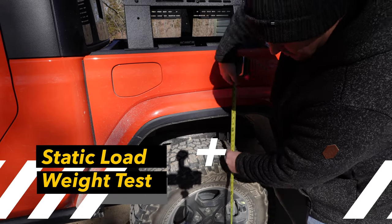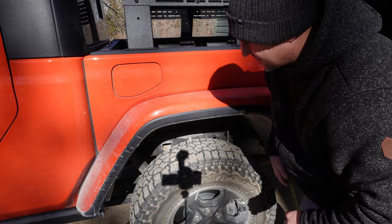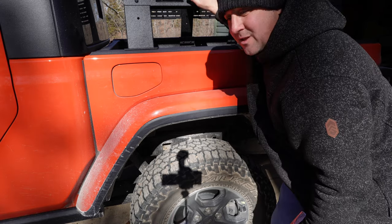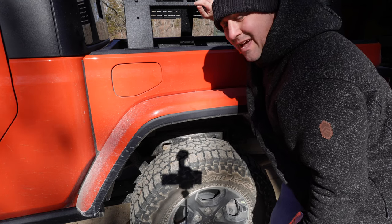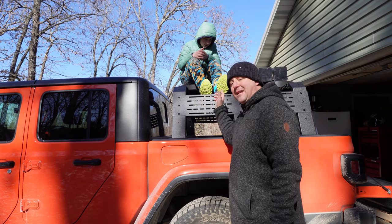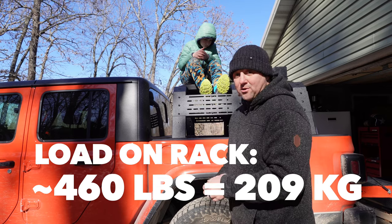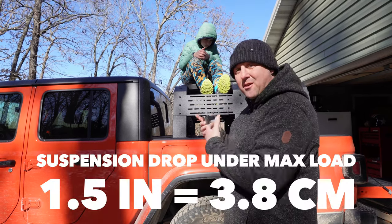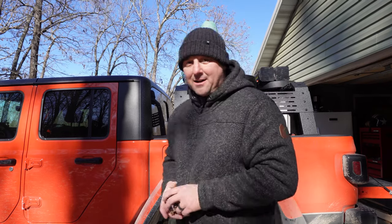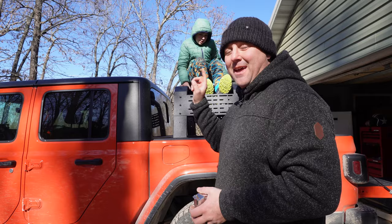We measured the fender height at just about 40 inches when we started, and with the 126 pounds on it, it's still just about 40 inches — so the weight didn't really depress the suspension. But let's throw some weight on to simulate 400 pounds. I've got four 45-pound weights at 180 pounds, and two 90-pound weights — another 180 pounds — bringing me to 360 pounds. Plus my son at 100 pounds, I'm at about 38 and a half inches. So if you load this thing down with 400 pounds, you're going to get about an inch and a half of resting sag. Overall, though, there doesn't appear to be any flex. Let's get these weights off and take this thing out on the trail.